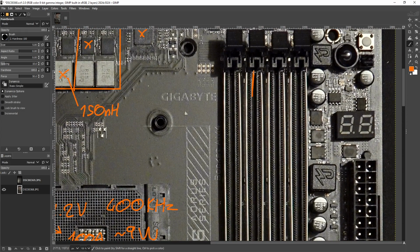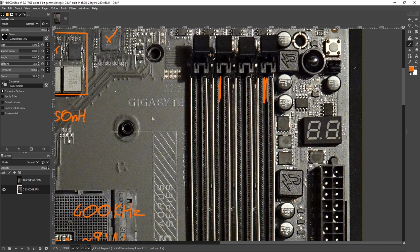Obviously it's a daisy chain, so it favors these two DIMM slots, but you can run 4x8, and, well, let's go through the different configurations. I should really be doing this more by ranks. The thing is, it also depends on what memory chips you're running and what CPU you're running. But as far as the daisy chain topologies that I've tested go, this is the best daisy chain. It is perfectly capable of pushing 4900 plus. Actually, not on X570. On B550, it can do that. Not on X570, because X570 doesn't really play well with BCLK overclocking, but over 4800 is certainly doable on single rank B die, which is very hard, actually.